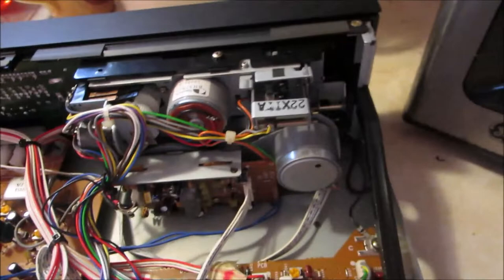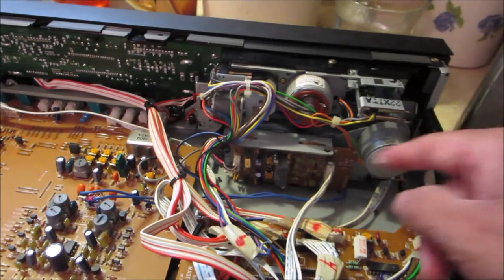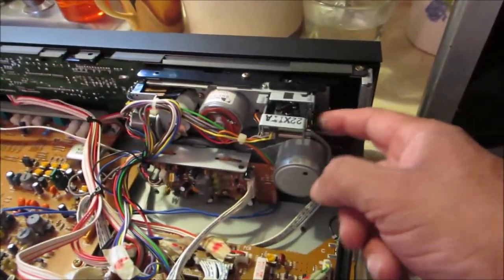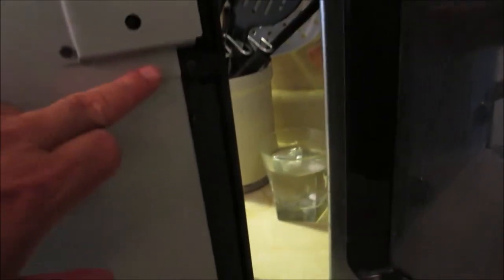This deck is very, very easy to change the belt. I have to remove the bottom cover, and then I'll have easy access. I'm gonna move this plate out of the way — I think it's one screw... yeah, two screws right here, one, two, and then I think one over here too. At the bottom we have four screws — one, two, three, four — and we're gonna go from there.